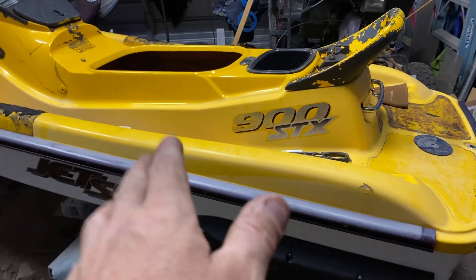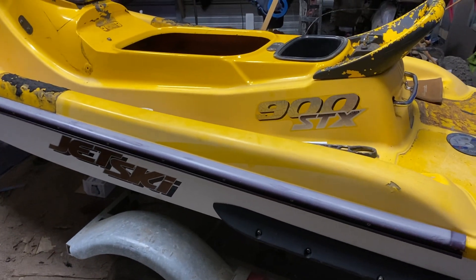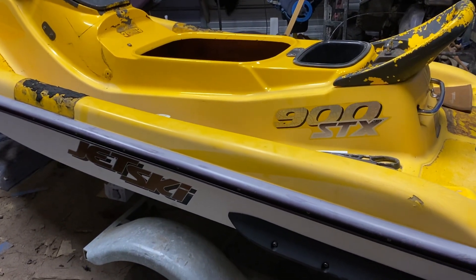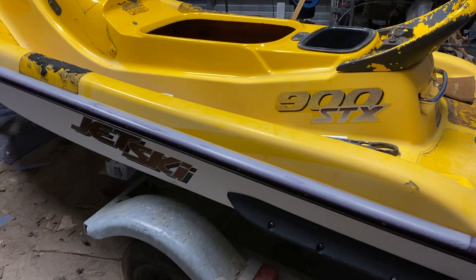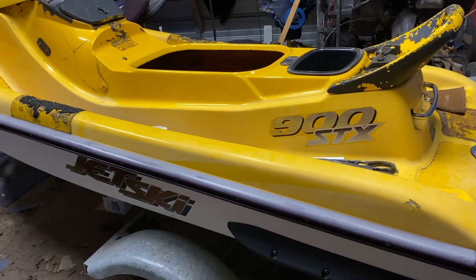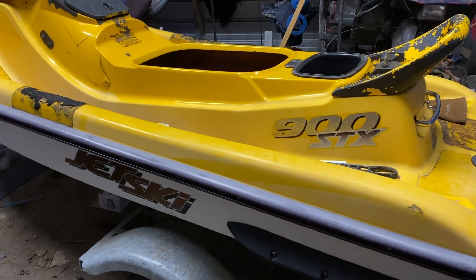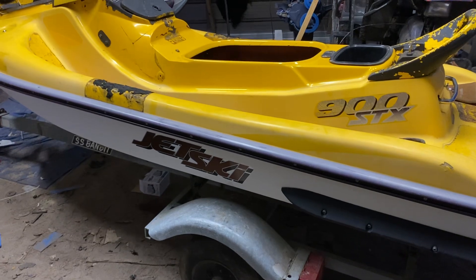This is all trial and error. I don't know if it's going to work or if I'll need a giant 8,000- to 12,000-watt motor. I've got the same motor on my racing four-wheeler, and as you've seen in some videos it's pretty fast — batteries last about three and a half hours per charge, and I've got two or three of them. If those batteries can push my four-wheeler 65-plus miles an hour with a 150-pound person and even ride wheelies, I don't see why it can't push this lightweight jet ski hull across the water.